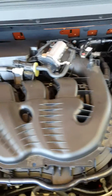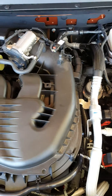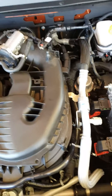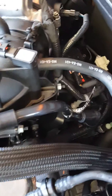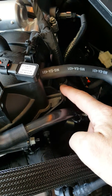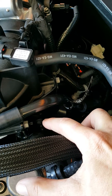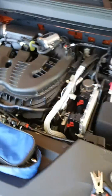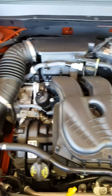And there you have it. I'll do a full video next time I change my plugs, which will be about 25,000 miles — I'm not a believer in letting spark plugs go for 100,000 miles. And I'm also not a believer in paying a car dealer $500 for a spark plug replacement. With a slight bit of mechanical ability and following directions, you can do this yourself. Here's the most important bracket — plug the hoses back on, tighten the bolt; it's easier to get to with a long reach half inch wrench. Get that back in place, tighten everything. There you have it — 2015 Jeep Cherokee Trailhawk spark plug replacement. $500 — heartbreaking. Thanks for watching.